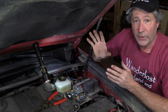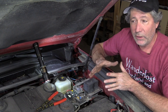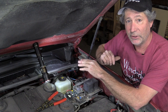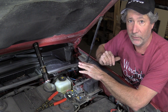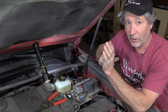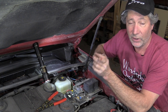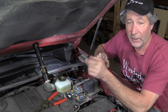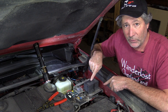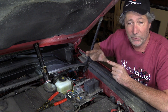Now, although all four of these lights together draw an incredibly low amount of amperage, we still don't recommend that you run through the firewall behind the dash and tie directly into the fuse panel underneath the dash. If you do choose to do that, make certain that all your wires, your connectors, and especially your switch are rated well above the amperage that these lights draw.